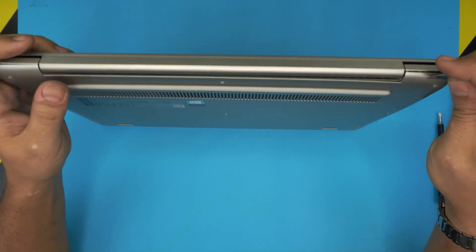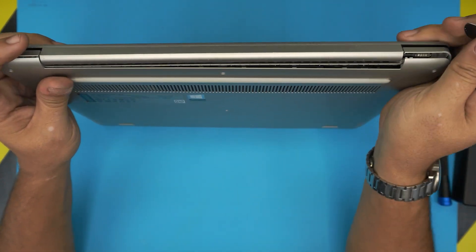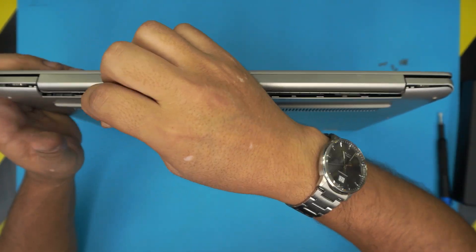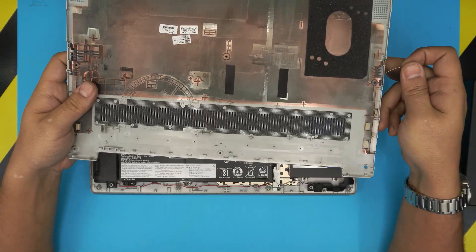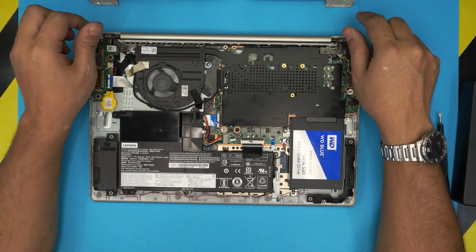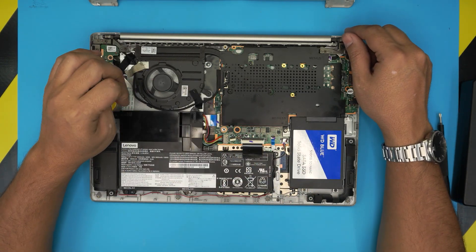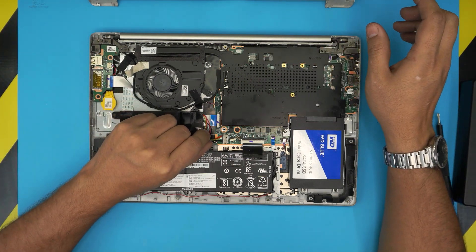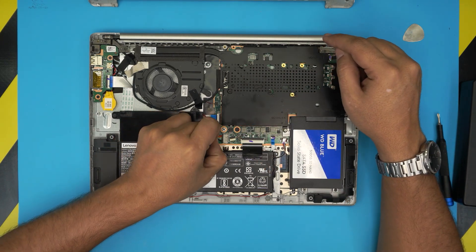Once you've done the sides and the front, go to the back. If it didn't come out, just twist and it should come out pretty easily. This is the bottom cover. Go ahead and use an old toothbrush to clean the mesh right here. Inside you'll see the battery, the main hard drive — I upgraded mine to a solid state drive — the fan, and the heat sink. Before doing anything, always remove the battery by pulling the cable backwards to disconnect the jack.